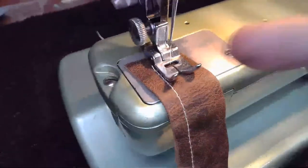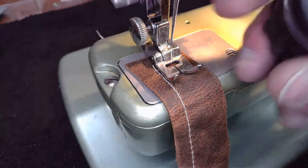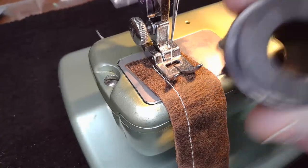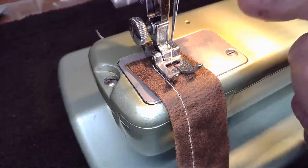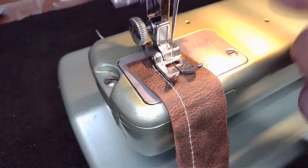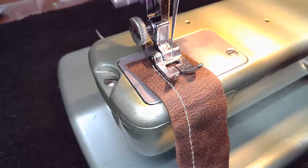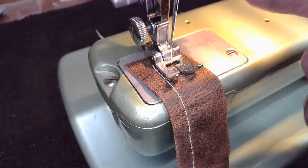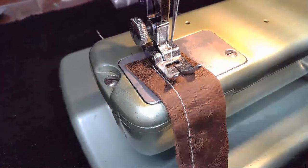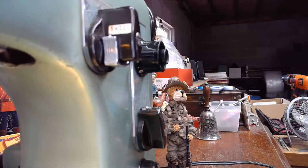And oftentimes that's an accidental thing. Someone tries to operate one of these machines, doesn't understand that you've got to have one of these in the back if you're going to be using anything that requires needle swing, and they'll kick on that foot controller and the needle will strike the throat plate. Sometimes they'll do it multiple times. It goes back to the old saying, don't do the same thing and expect a different outcome, but they'll do it anyway because maybe they think their needle is bent. Then they end up hitting that throat plate opening multiple times and creating major scarring issues. So have one of these in the back if you're going to be using the cam functions of the Swedish Beauty. Okay. I know I went over that multiple times, but it's really an important point, and it could save you a lot of headache.